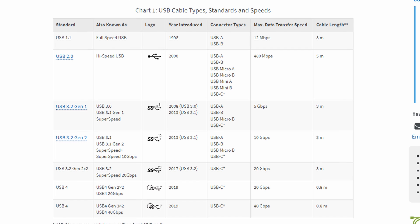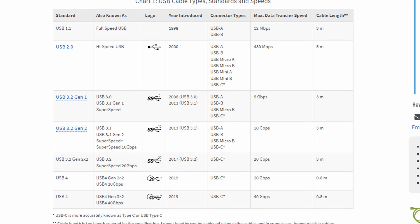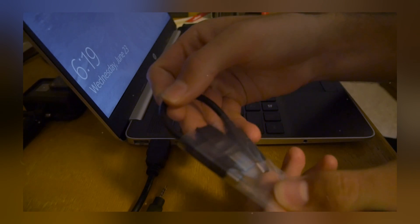I think you'd want something with speeds at least over 100 megabytes per second reading and writing. Something else to think about is what ports your computer has, because there are different speeds of USB ports — USB 3.0, 3.2 Gen 2, even USB 4.0 may be coming out soon. Thunderbolt — there are a lot of different ports out there. I got kind of lost in the weeds figuring out what my computer had. Turns out it has USB 3.0, and in just a second I'll talk about whether that's going to be fast enough.